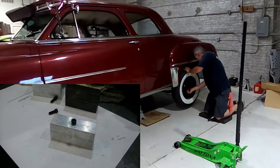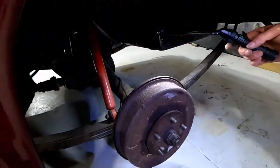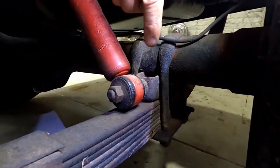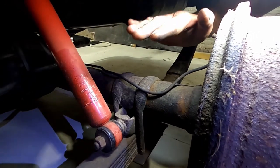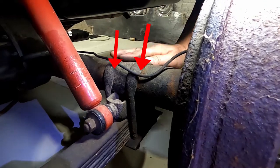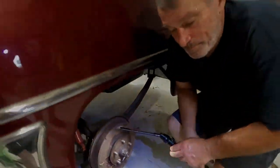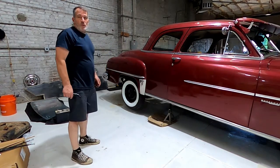So this is what we're starting with: an axle over the spring and shock mount. The idea is to put the lowering block in between the spring and the axle pad — that will raise the rear end, which in turn lowers the car that same amount. What we're going to do is lift the other side, put a jack underneath it, disconnect the u-bolts, raise the rear end, insert the blocks, bolt them back together with the new u-bolts and blocks, set it down, and we're rolling low.